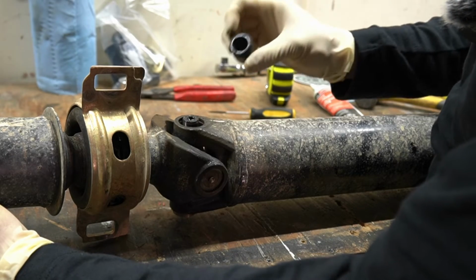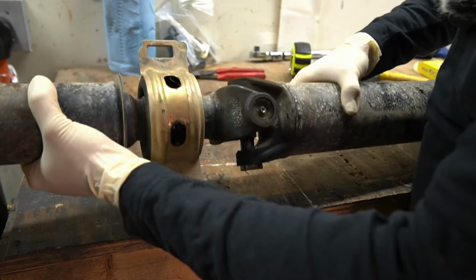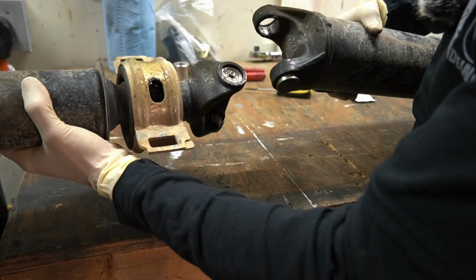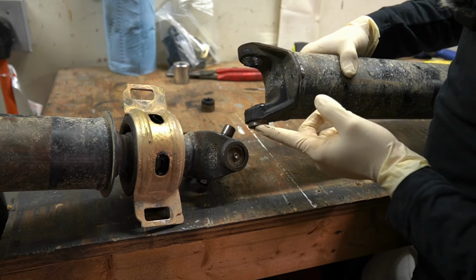The little needles that are in these caps can get broken or lost, and then you're just kind of out of luck there. But with our cap removed on that side, now we can swing this over, and that allowed us to actually separate the shafts. And then we'll just take a chisel and knock this other cap out.